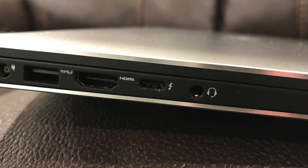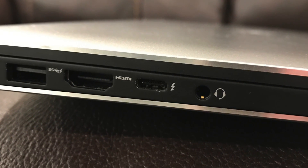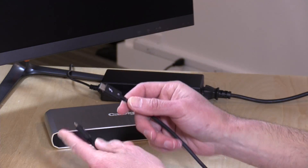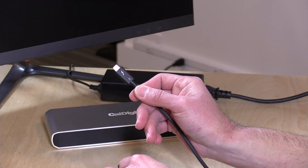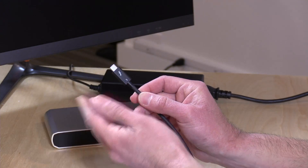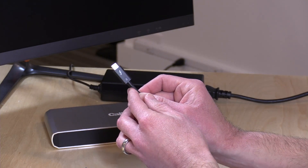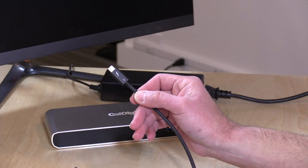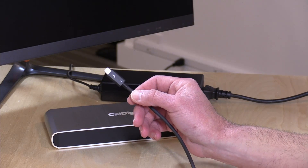I have a Dell XPS 15 that has a Thunderbolt port on it, designated by a little lightning icon on the connector so you know it works. Likewise, if the included cable is too short, you can't just go out and buy a USB Type-C cable that's longer — even though it looks the same and fits in a USB Type-C connector, these cables are very different. So be very careful to use only a Thunderbolt 3 cable, otherwise you won't have much luck getting your dock working.